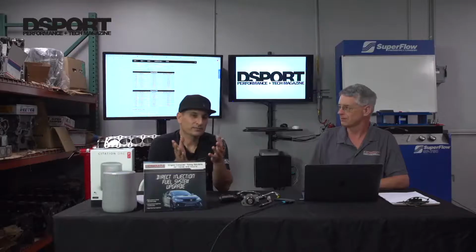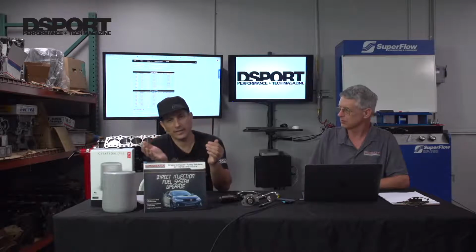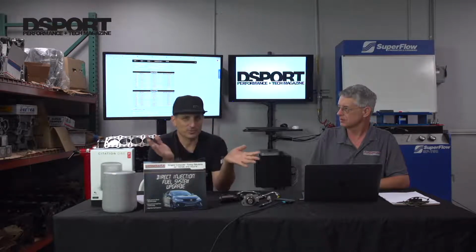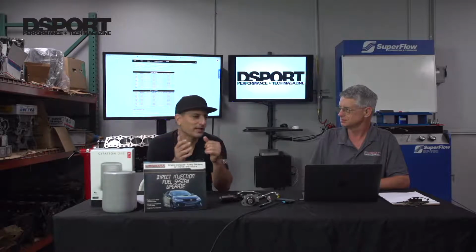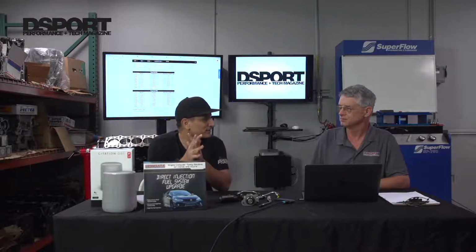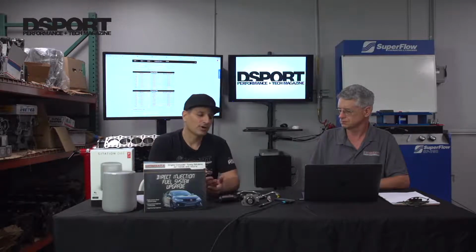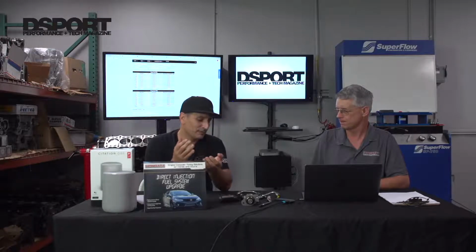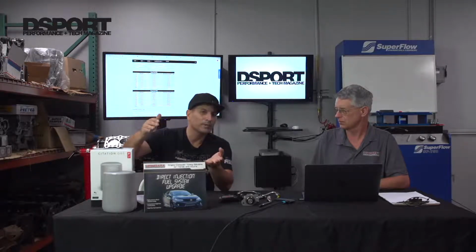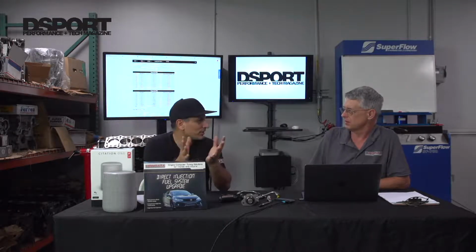Well, and the nice thing about E40 to E50 also is you're going to get some extended range out of the vehicle too. If you go straight E85, you're losing 40% of your mileage. Yeah, at E45 or something like that, you're closer to only losing about 20%. So yeah, it is that sweet spot where the advantages you're getting from the fuel and the additional cooling and all that good stuff are happening. It does add a little bit as you go from E45 to E85, but it's minimal compared to what you're trading off.